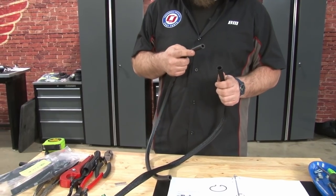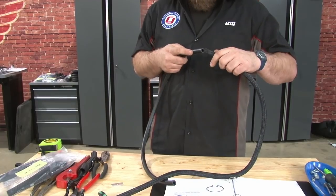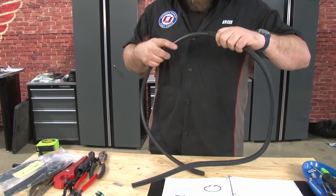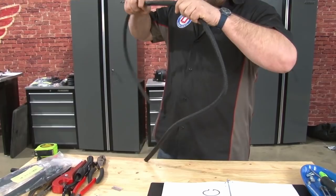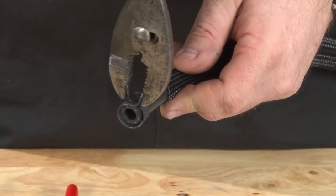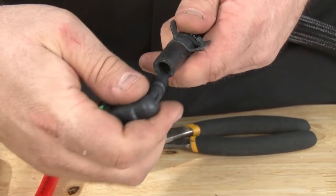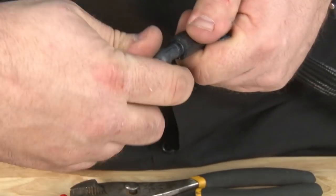Now you're gonna grab the 36-inch 3/8 rubber hose included with the kit and the sleeve from Hardware Kit D. Wrap the sleeve around the hose. Now we'll pull out the sleeve, grab some of the supplied clamps, again from Hardware Kit D. Put that over. Install the fittings we just removed from the factory hose.